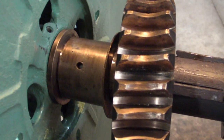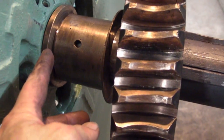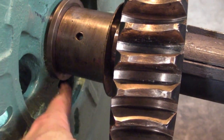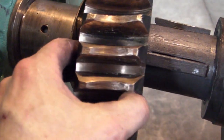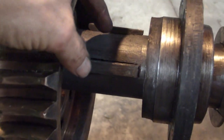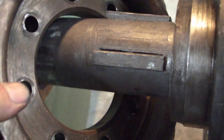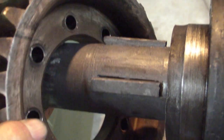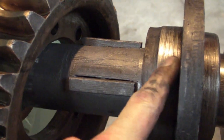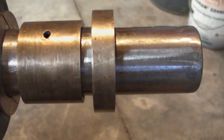I'm glad I make videos because I don't take notes when I take things apart, so it's nice to go back and look at the pictures. Proper reassembly of this thing is: thick washer, bushing, thin washer, the gear for the worm drive, the woodruff keys, and the hub with the large side pointing inward because the recess points toward it — the recess goes over the extended section of the hub. Then skinny washer, bushing, fat washer.